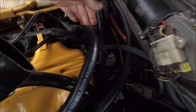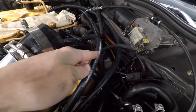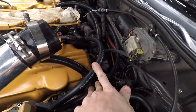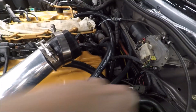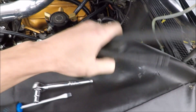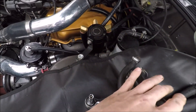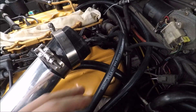The hose is on — you can see it right here. It's connected behind the lower intake manifold and comes over into the left side turbo coolant line. It looks a little funny up here just because it's a brand new hose with some spring to it, but once the plenum's on it sits down. That's the coolant bypass mod on a Z31, pretty much the same throughout all years. I replaced four lines with two much longer ones — a lot less clamps and a lot less likely to leak.